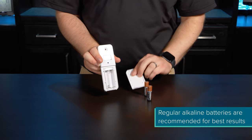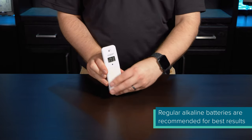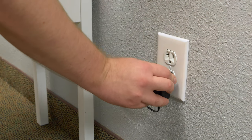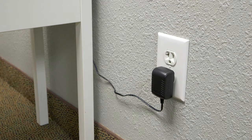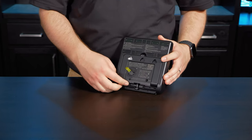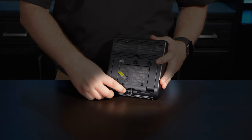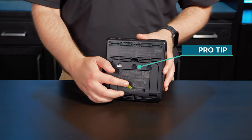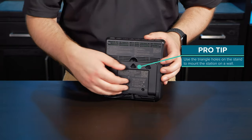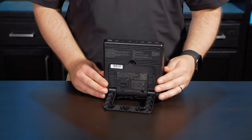Out of the box you'll first want to install a new set of AA batteries into the included outdoor thermo-hygro sensor. Next, power up the display by installing the power adapter into an outlet and then into the bottom of the station. Use the built-in cord management holes to help keep your space tidy. From there, activate the backup battery by removing the installation tab, and then use the friction control pull-down stand to allow the station to sit upright on its own.